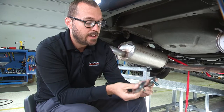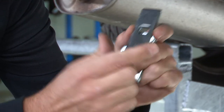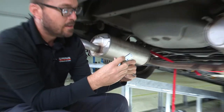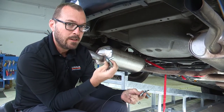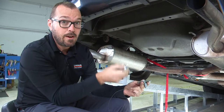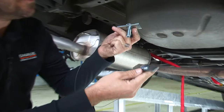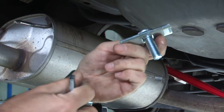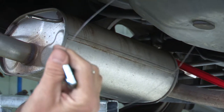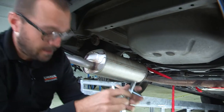Provided in our kit are six bolts and six nuts, washers, and these square retaining plates, and we're going to install these up into our frame rails. Note that the shorter inch-and-a-quarter-long carriage bolts are going to be installed in the frame rail, while the longer inch-and-three-quarter bolts are going to be installed in the rear cross member. We've also got a fish wire included in the kit that's going to help us install these components.